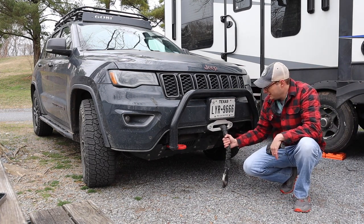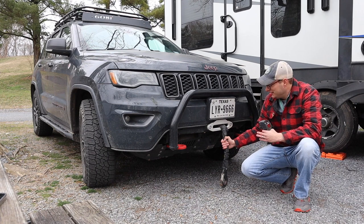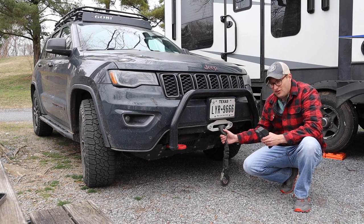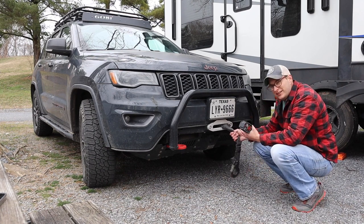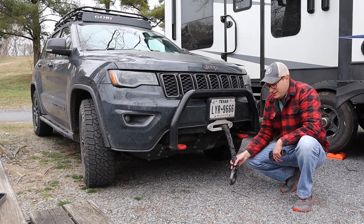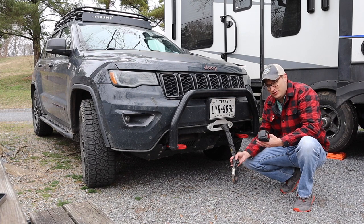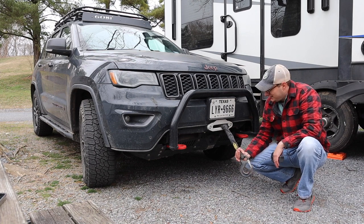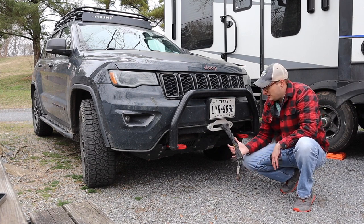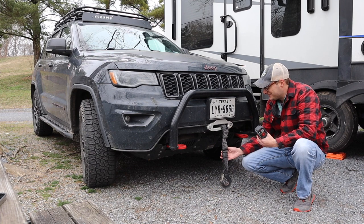This is in free spool right now. Actually just yesterday I had this winch line out, took the whole thing out, and inspected it. What I've been finding is that this sleeve is just getting all kinds of caught up and doesn't want to pull out easily. So when we're out on the trail and I can't get my winch line out when I need it — I've been able to get it out, but I don't always look like a super stud doing it. This is really getting bound up in there. I really want to get this off, but I don't want that line to be exposed to sunlight and potentially damage it.